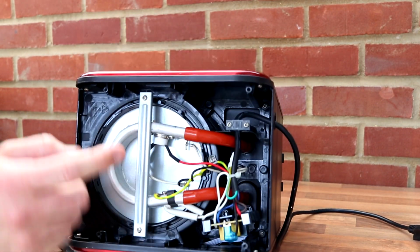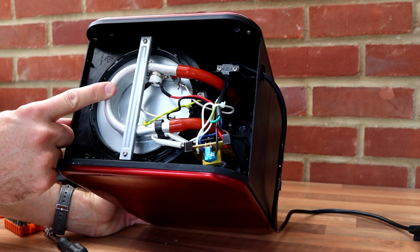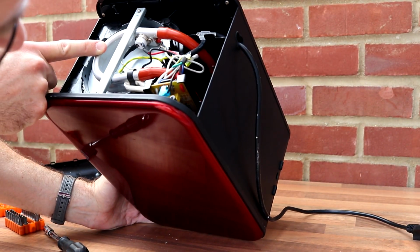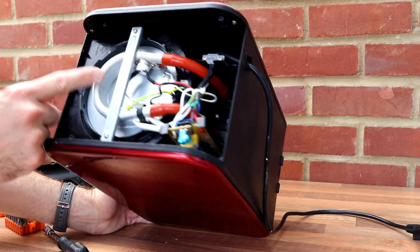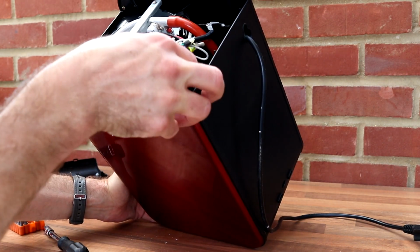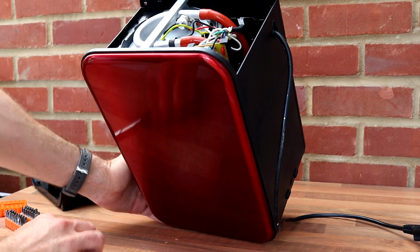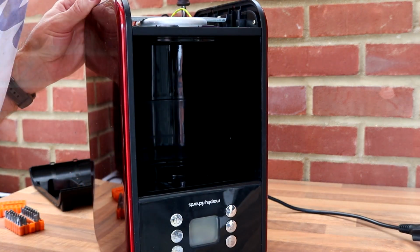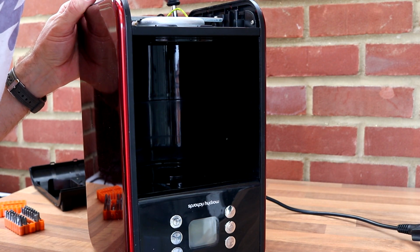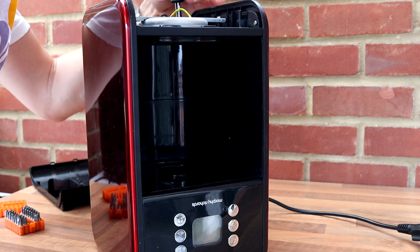But mine, the heating element's gone. So I'll test it for continuity. Yeah, there's nothing else here. I mean, I've had a quick look to see if there's any fuses. Can get the board out, I suppose, can't we? Can reach the board. I suspect it's a weak point. The element. It's always getting red hot.